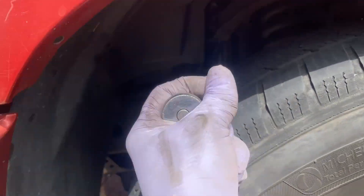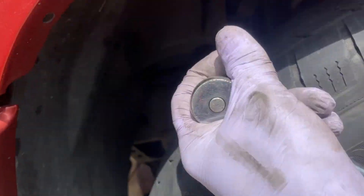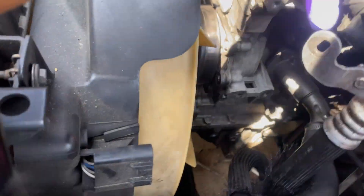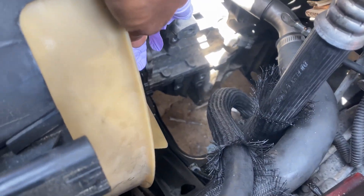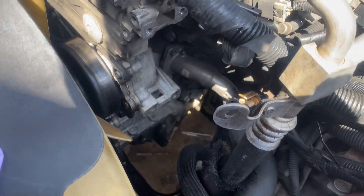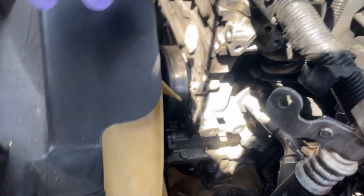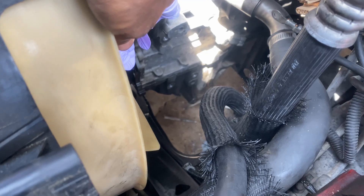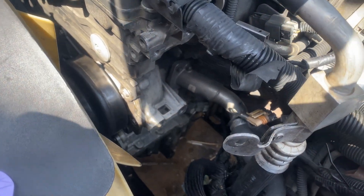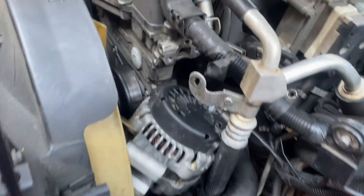There's the top left. The top right — you have to get that one too. Can't get it from the bottom, so we have to move the idler pulley right here. I'm going to squeeze back in there. We got the old one out, but let's see — okay, we have to put the new compressor in now.